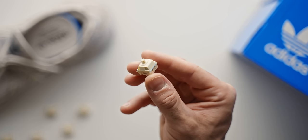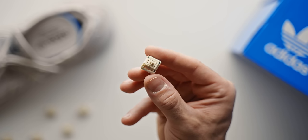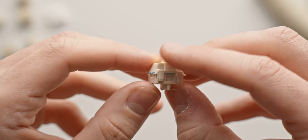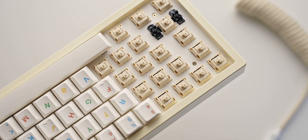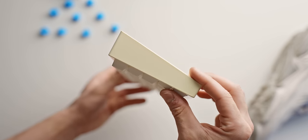For the first time ever I also tried using switch films to give the housing a bit more stability, but in the end I just removed them. When I actually installed the switches onto the board, the keystroke pressure became a lot firmer and more inconsistent. The nice linear Cream switches felt more like 100-gram tactile switches for some reason. Removing the switch films made them feel normal again, so not really worth the hassle for Cream switches — they feel pretty solid without them in the first place.